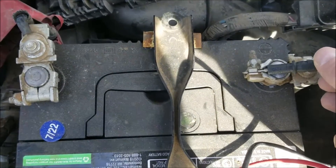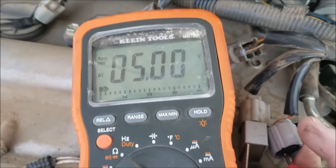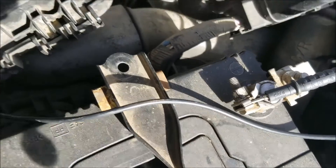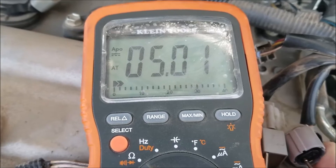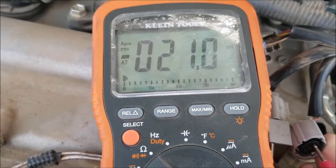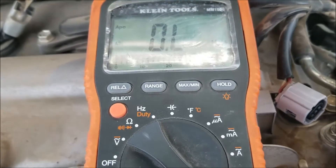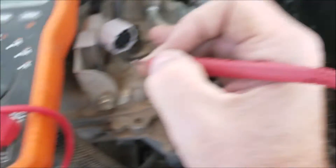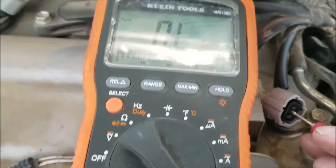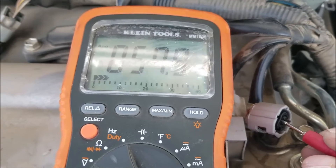I always go from ground on the battery rather than the center pin, to avoid accidentally blowing a fuse. On one of the outer pins I'm getting five volts DC — that's the reference voltage wire. On the other outer pin the voltage is jumping, which is very likely the signal wire going back to the onboard computer. Setting my meter to continuity and going from ground to the center wire confirms the ground wire is good.